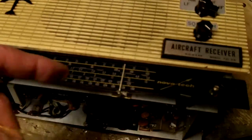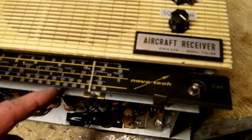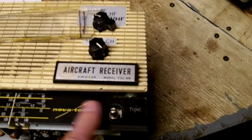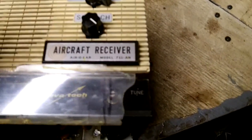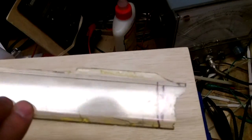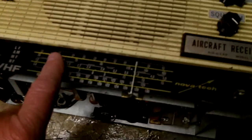What I'm going to do first is I've got to do something with this because when I push this radio in it's dragging and making all kinds of noise going in and out of the cabinet, and it's going to break off this thing and then I have no dial. I've got to clean inside here. I sure wish I can get some dial light on here because I just can't see this dial at all without a flashlight. The dial glass slid right out — I thought for a minute the dial cord was riding on this, but no, the dial cord is riding down here. It was just hooked a little bit on the pointer. I just had to pull one of the knobs off, and what I'm going to do is cut this where I marked it because this ragged edge serves no purpose but making it look ugly.